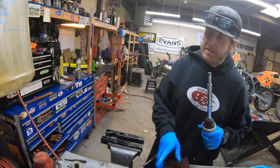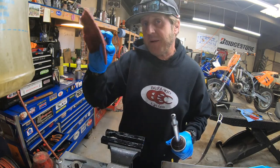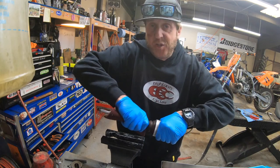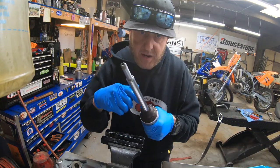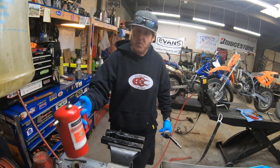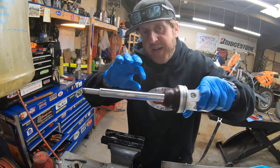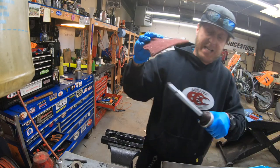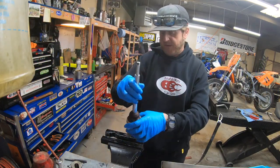With this shaft, just like fork tubes, put a cross-hatch on it — a lot of guys call this a micro finish, I call it a cross-hatch, whatever you want to call it. Too many people charge a bunch extra for 'oh, I'm gonna micro polish it.' I just micro finished your shock shaft and it took maybe 10 seconds. What that does is put a tiny cross-hatch in the chrome, which helps it hold a very thin film of oil so the thing slides even smoother than stock. I'll go over it one more time so there's a solid 20 seconds in it. Look at how shiny and pretty that is — that's what I'm talking about.